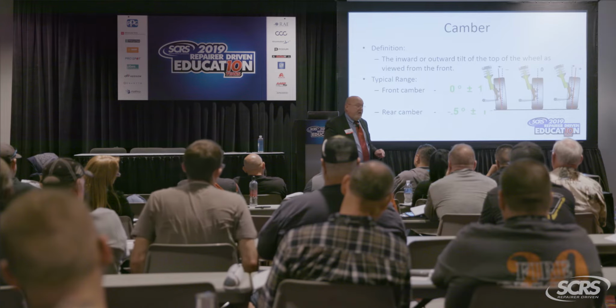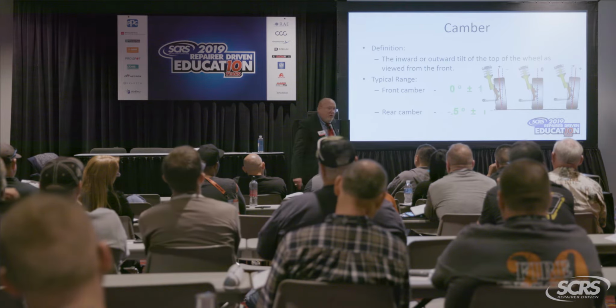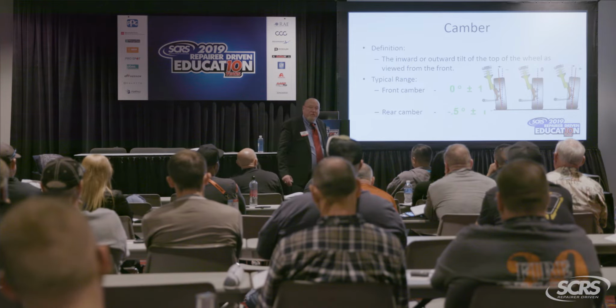I say it's just barely in the green. That's an issue. We need to get it closer to the middle. You know, we don't want too much positive on one side, too much negative on the other. You're going to learn here in a minute that's going to cause a pull force.